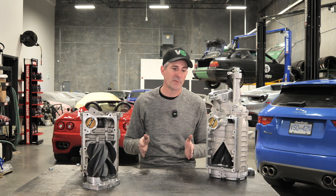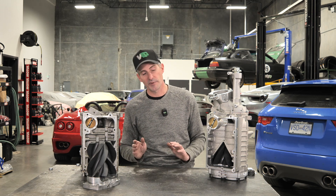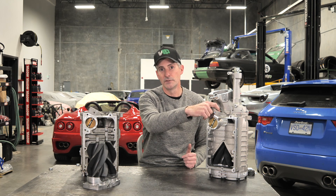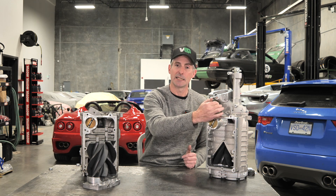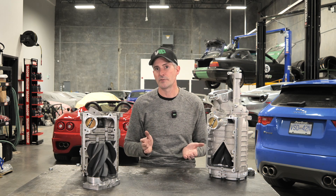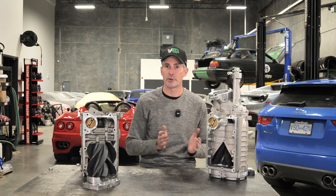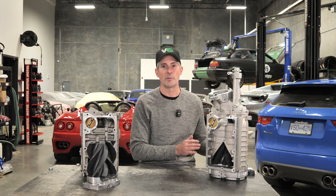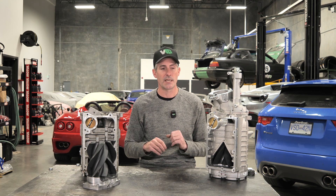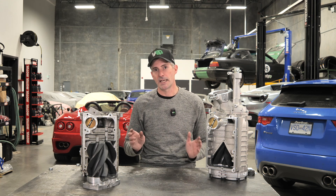What was actually happening is that someone couldn't figure that out, because pictures surfaced from another company in the UK working on a late-model electric-motor bypass valve vehicle — and they had that motor zip-tied out of the way and a vacuum-actuated valve inserted in its place. Because they couldn't figure out how to solve that issue tuning-wise, they simply reverted back to the way the previous generation of vehicles worked. Somebody else then uncovered it and started talking about smooth throttle tunes as a problem only they had solved — when in actuality it's a problem we ran into nearly a decade ago and solved pretty quickly through data logging.